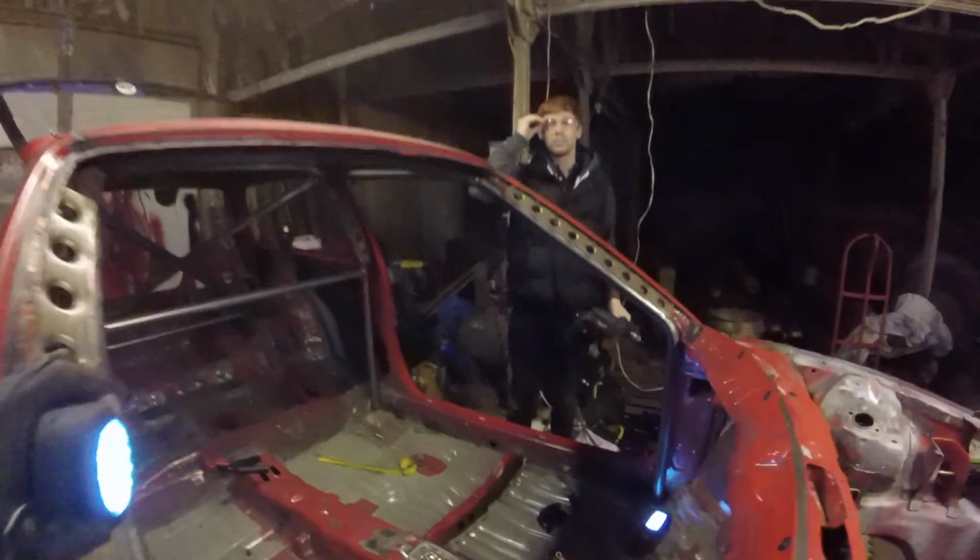Now we're about to drill the holes in the wheel arches for the brake lines or the brake fitting. So my preferential spot is just there. Hopefully what we can do is we can bring the brake line out here, loop it, and then down into the soft line. Dan's starting it already by the looks of things from the wrong side. So Rob didn't trust me, as usual, and made me drill him from this side. That was my first guess, and that's where it came through.